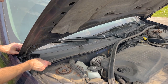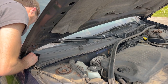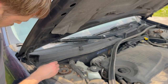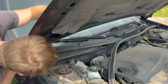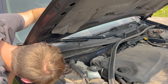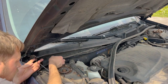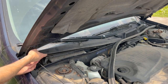You may not actually have to remove this whole cover — you just need to lift it up and it will expose another cover underneath. Behind that, there's another plastic cover piece that just sits in there with a couple of protruding parts. Lift that up and underneath it is actually the cabin air filter.